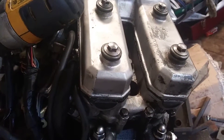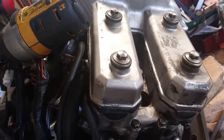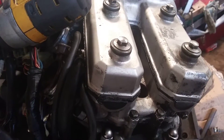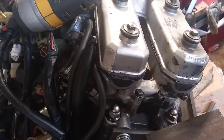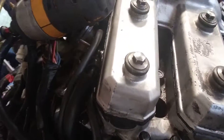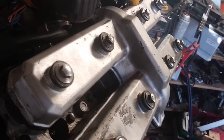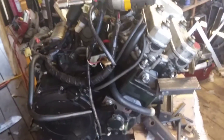There's five valves per cylinder — three intake, two exhaust. The whole top of the cylinder head is pure valves, so there would have been a collision. Now there's a chance it could be off by one tooth or something like that, but I don't think it is. So that's what I've been working on.